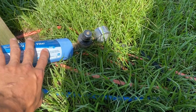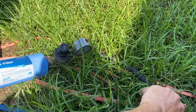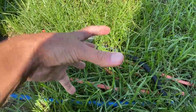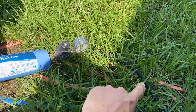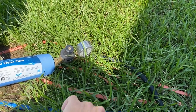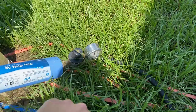The other thing you might want to consider is a water filter — these are pretty cheap and you change them out every couple of months. And then get yourself a nice flexible drinking hose. This one is flexible, does not kink, and is a lot easier to handle than those big bulky white ones. Consider getting one of these flexible drinking hoses so you have nice, good drinking water coming in. So: water pressure regulator and a nice hose are must-haves; the filter is a nice extra but not strictly required.